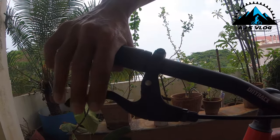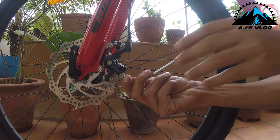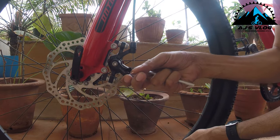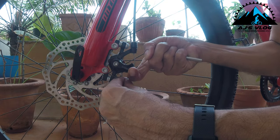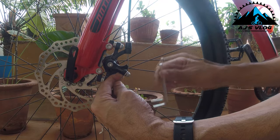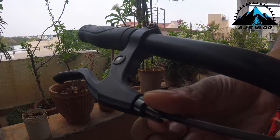Press the lever and see how far up the holder goes in your brakes. First, loosen the bolt so that the cable is loose. Next, manually push the caliper lever up so that you can adjust the cable. Pull the cable down and tighten the bolt. Now this should be about right. You can use the screw for minute adjustments.